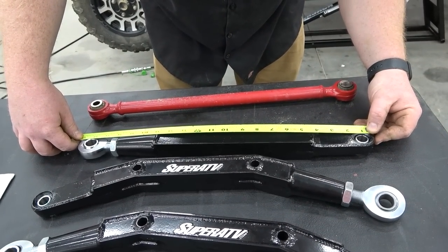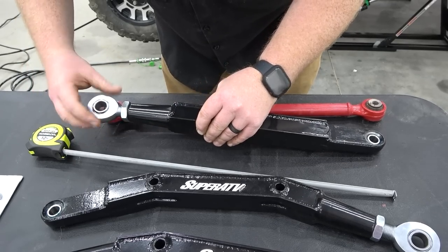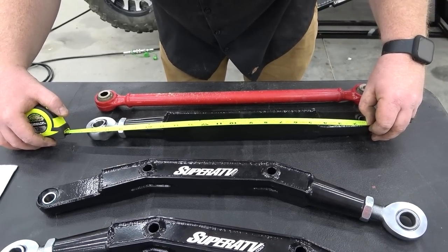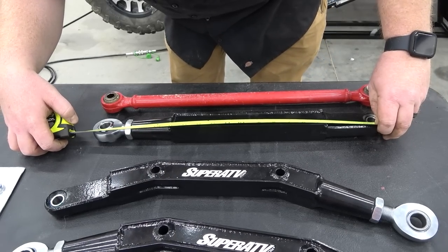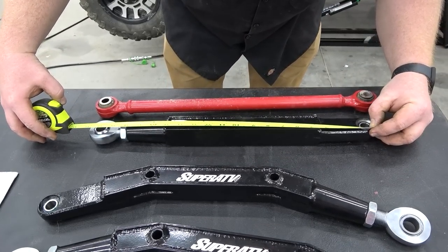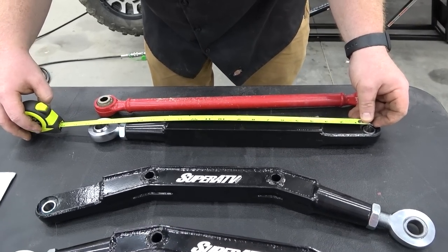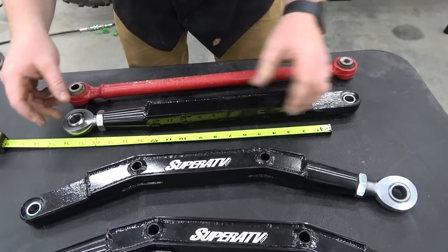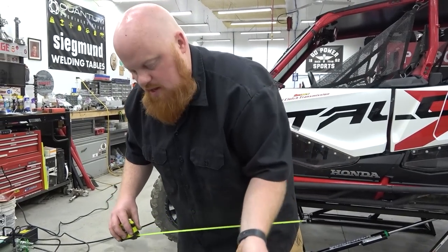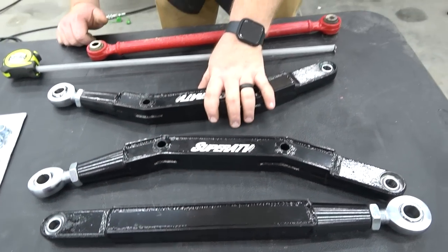So we're measuring at 19 inches — lay that measurement tape centered, we're at 19. I'm going to wait to tighten the jam nut until it's on the vehicle because the two halves will hold it together. We're going to go ahead and adjust out the rear which needs to be 20 and 3/8ths. They actually set this thing up perfect right out of the box. Going to adjust the other side while I'm here, then go back to the buggy and install it.